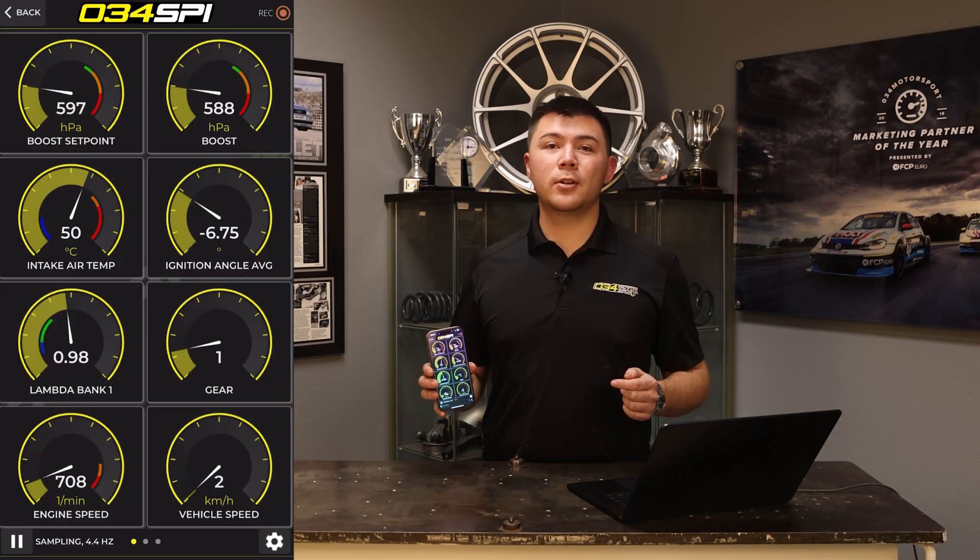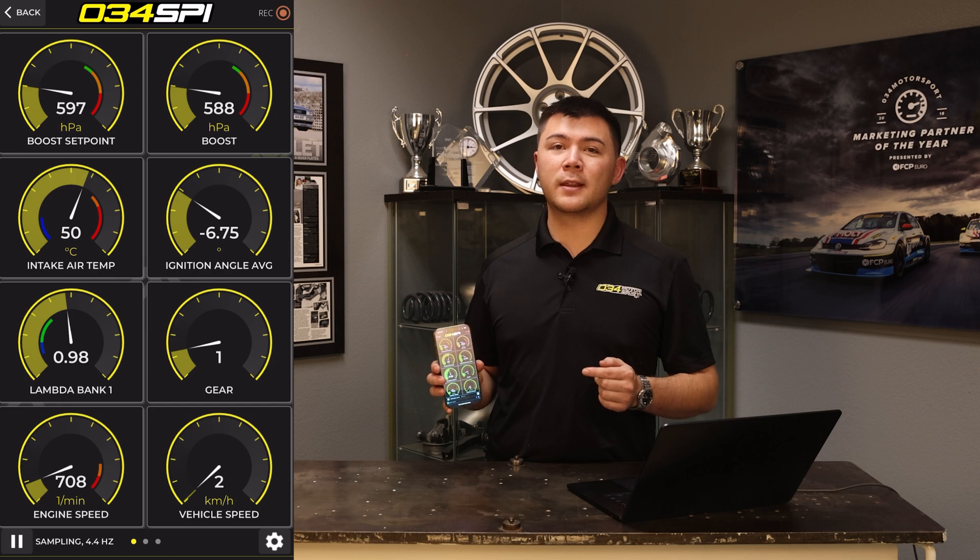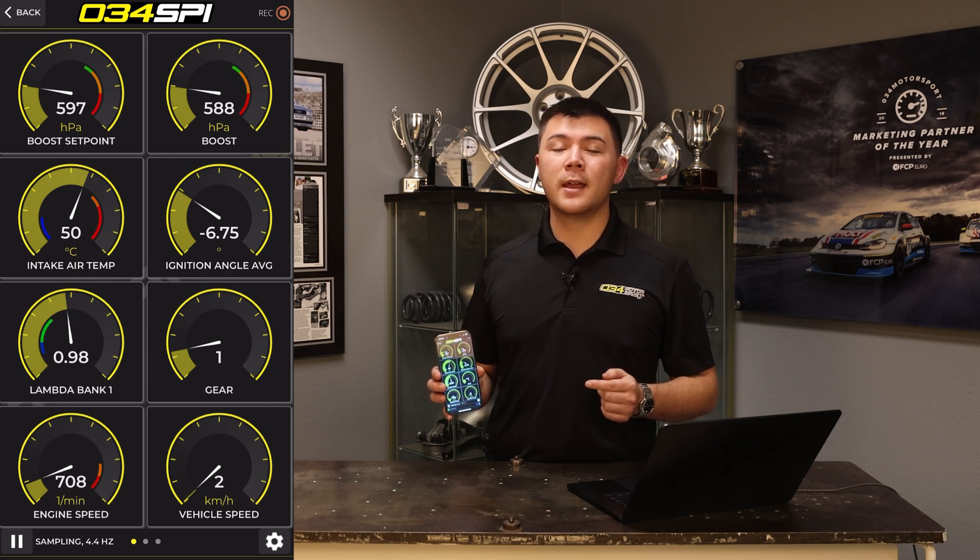Once you select the appropriate data view, your device will transition to a screen showcasing the information output by your ECU and is now recording a datalog. Once you begin datalogging, you can set your phone to the side or into a phone mount. Accelerate your vehicle to third gear at about 2000 RPM, then go full throttle — right before the kickdown switch if you're in an automatic, or full throttle if you're in a manual. Allow your vehicle to accelerate all the way to redline, let it shift to the next gear, or shift yourself if you're in a manual. Once you've shifted to the next gear, come to a safe stop and end the datalog.